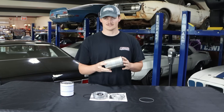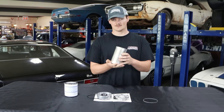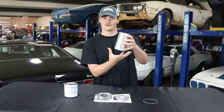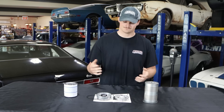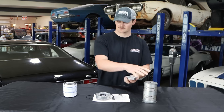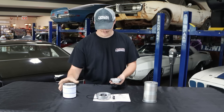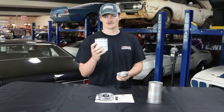These original 67 canisters work fine, they function amazingly. The only problem is getting a hold of all the parts to use them. We offer the filter itself, but we can't hardly get a hold of the actual canister that bolts to the block. That's why we offer an alternative — adapters to transition from this oil filter to your modern style oil filter. Let's walk you through what you've got to do to change your early GM production block to the new style oil filter.